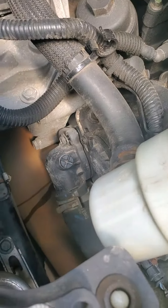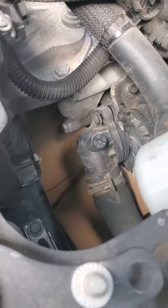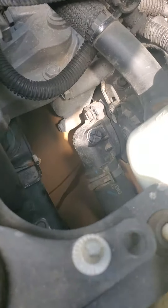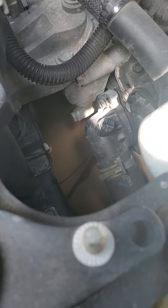One extra trick: you'll see down under here there's a piece of cardboard that I wedged underneath the thermostat to divert some of that coolant away from all the belts and pulleys. Look underneath and put some more cardboard — you can see it's dripping as I started to loosen the two nuts.